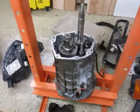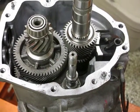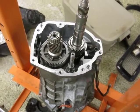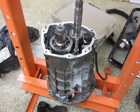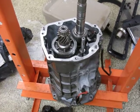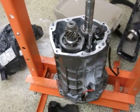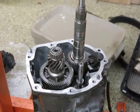A little complication: one of the issues I noticed when I took this apart was that the 5-6 gear came off very easily. That's not a totally uncommon problem on T56s — several people have mentioned their 5-6 gear was loose. If you leave it loose too long it can really damage the splines on the main shaft and on the gears and you need to replace both. Since the splines still looked good, I sent the main shaft out to Texas Drivetrain Performance. They add some welds to it and machine it back down to spec but slightly proud of where it was. Unfortunately now that 5-6 gear is being a real bear and doesn't want to go down with the mallet, so I'm going to set it up in the press and press it down.